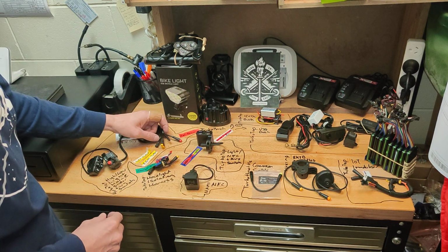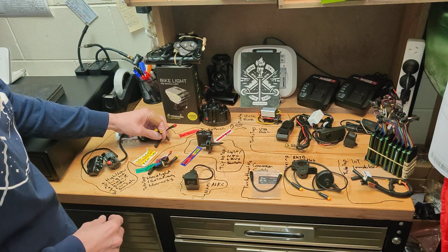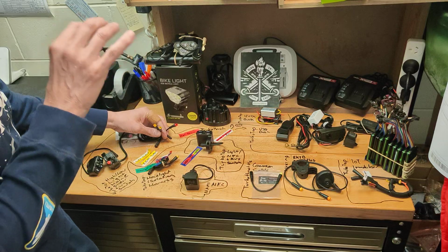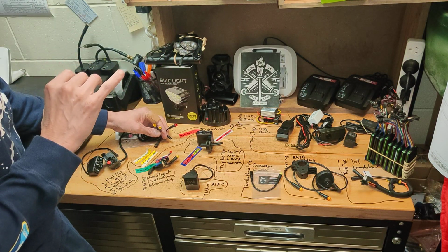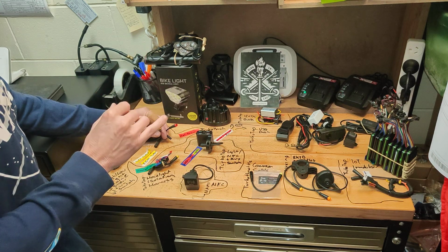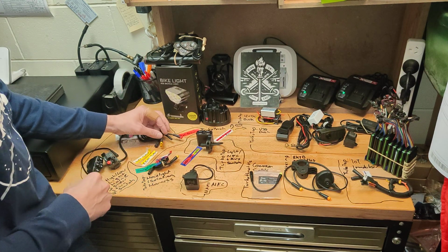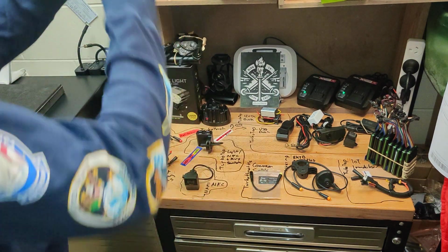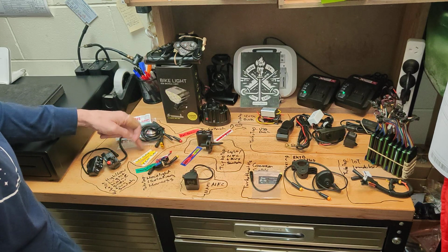There's also some other outputs on the design, functionally, to provide the ability to plug in your front turn signals, the NAMI front turn signals. So they're a white DRL light that's on all the time, and a left and right yellow. So that would allow you to connect those straight into here without needing to get a V3 mainline and new turn signal compatible mainline you've got to run down the stem. So that's those two left and right turn outputs.